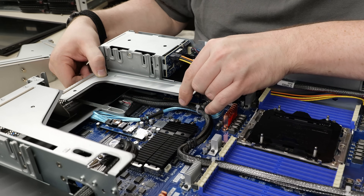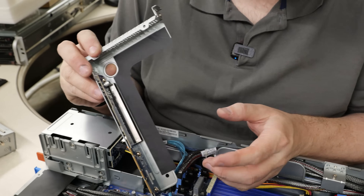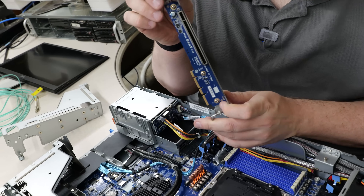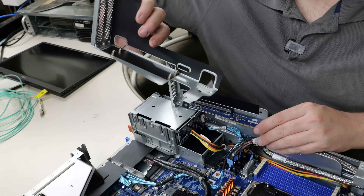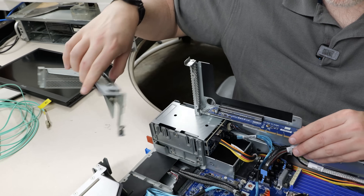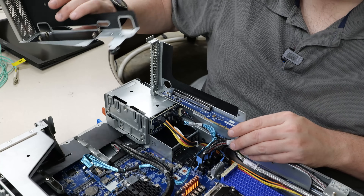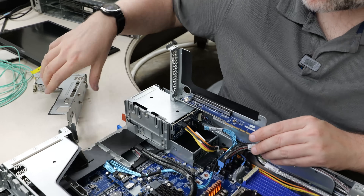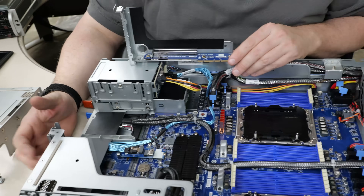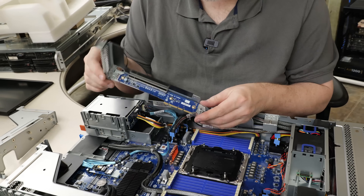Because we have the option of so much PCIe at the front of the chassis, Gigabyte opts for modularity. We've got a PCIe Gen 5 x16 slot on the bracket at the back. For expansion slot things, you get a PCB that connects to an MCIO connector. You can take two x8 MCIO connectors and route them to the back. So there's a lot of room for expansion — two full-height half-length slots plus one half-height full-length slot.